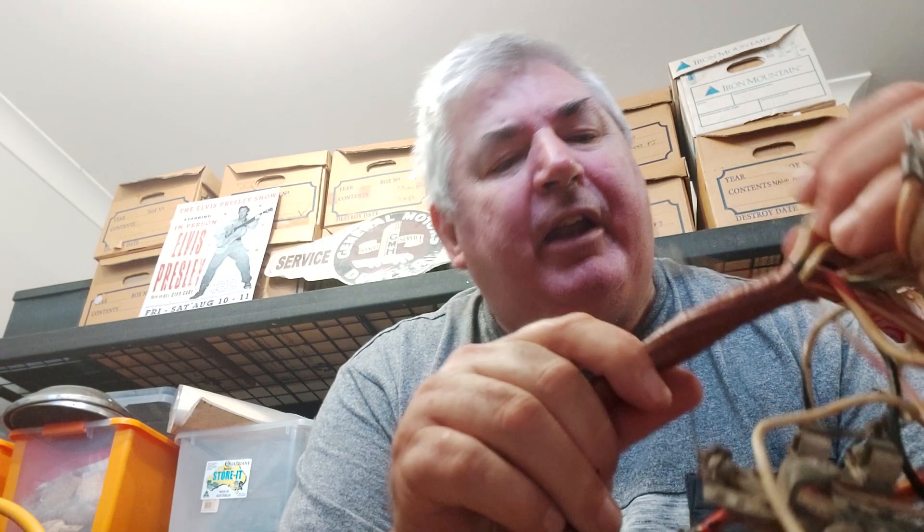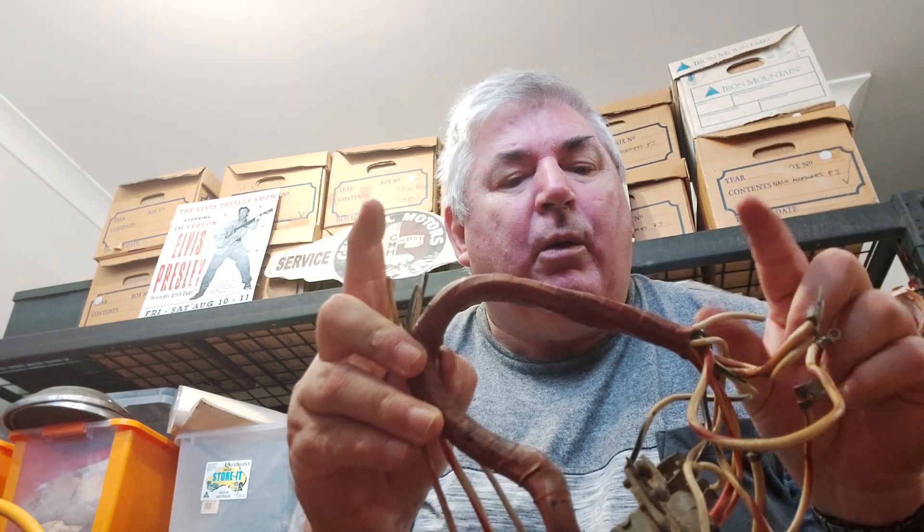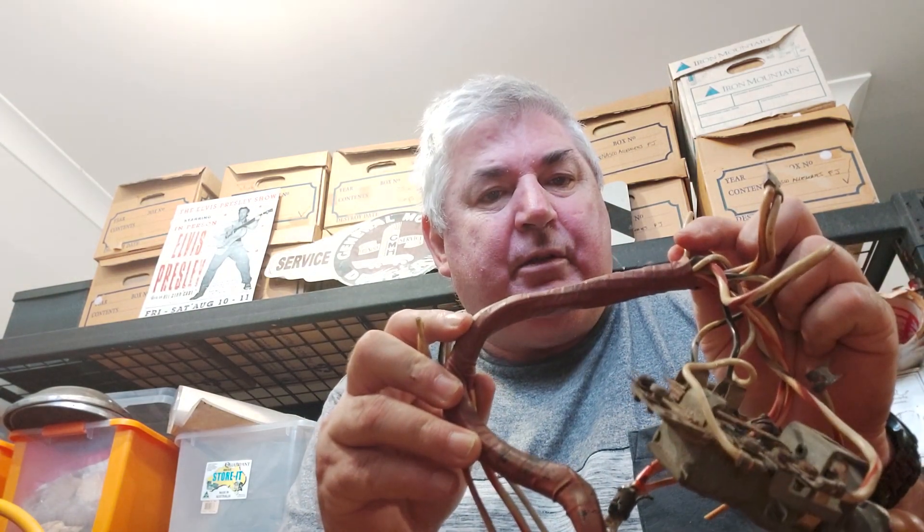What I'll do is figure out what this natural wire was. If it's exposed, say, 12 centimetres, I might go 15 centimetres back, open this all up, and use zip ties to keep things together. I'll go back 15 centimetres, chop that wire, then get the appropriate gauge wire — the same gauge type — chop 15 centimetres of that, and join the new wire to the old wire. So I'm transplanting wire in there to give me the original wire exposed, then put the appropriate ending on it. I'm restoring this wiring harness because it's not perfect, but by the time I finish with it, it will be.